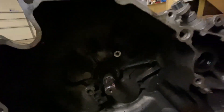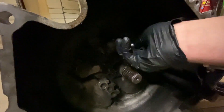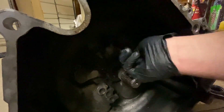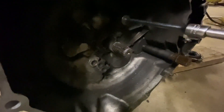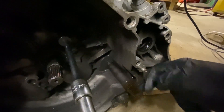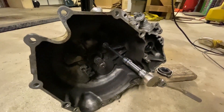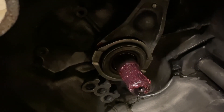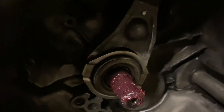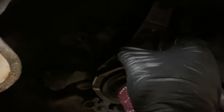Down here on the trans, I unscrewed the old fulcrum ball and the new one basically just screws in - it's a 17 mil. I'll screw it in and tighten it with a socket. Then I'm going to put the new fork on, clean and grease the input shaft as well as the output shaft for the transfer case, and then put the fork back on. The new fork is in, regreased everything - where the fulcrum ball is, the throwout bearing where it slides on, and right here on the shift. There's basically no play.